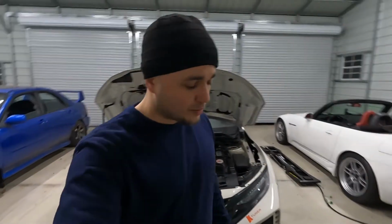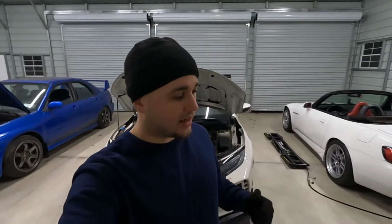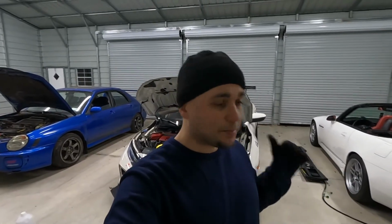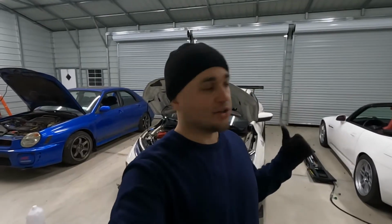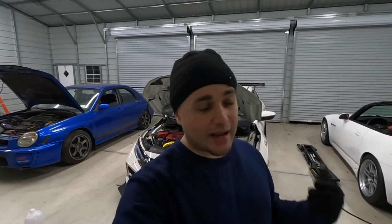Heat at the track. Well, this thing gets super hot at any track day that you take it to. It could be a fairly cold day and it still gets super hot. And while you can do a really fast couple of laps, it will start pulling timing, especially if you're tuned. If you're not tuned and you have some of these modifications and you add speed holes to your hood or hood venting, it'll last much longer out at the track.